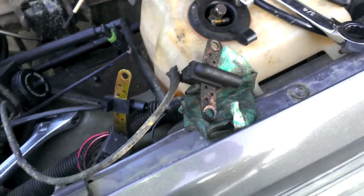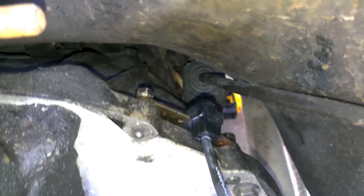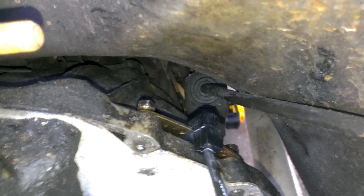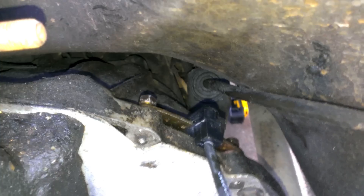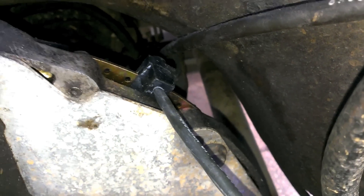There's the sensor and the bolts are hand-tightened. When doing them from the top you have to push them in real far, otherwise you'll just be spinning them and they won't grab the threads. I hand-tightened as much as I could, then got underneath to tighten them. CPS should be good to go — I'll hook it up when the rest of the engine is in place.